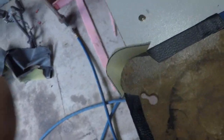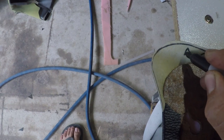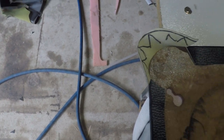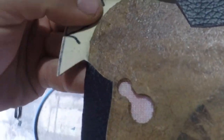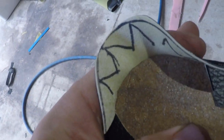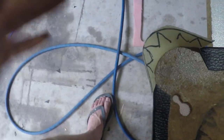Now that this bottom section is mostly wrapped, I've just left the corners unwrapped. Now, something with a wide corner like this, you would typically need to take a series of triangles out of it. So you're cutting a pattern, something like that. But because we've used a 10mm foam, which is probably a bit thick for this application, it's safer if you can stretch the vinyl over a bit and just stick it just to the outside edge of the board there. That way we know where exactly it's gonna finish.